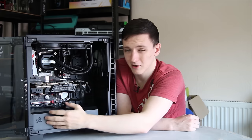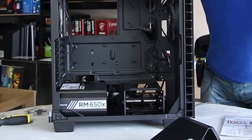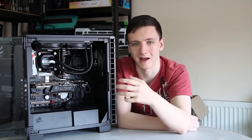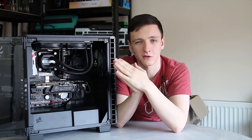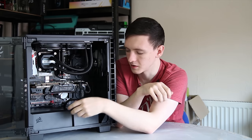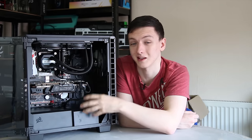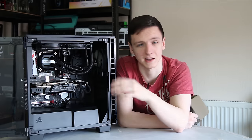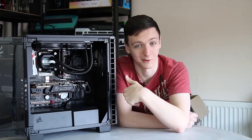The main thing with this one and the power supply basement is that because of the positioning of the hard drive cage, the power supply can only really be standard length. You can remove the hard drive cage if you're using something like an AX1200i, but the space left for cables and cable management is pretty minimal. I recommend installing the cables for a fully or semi-modular power supply first before putting the PSU into the system. If you're not using 3.5-inch hard drives, I definitely recommend removing that cage straight away so you have plenty of room.